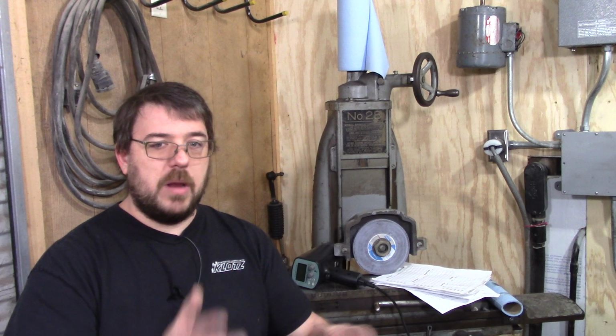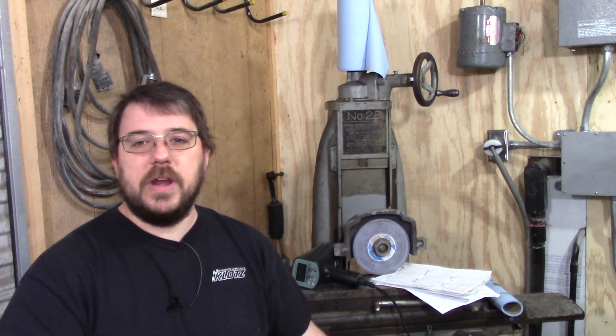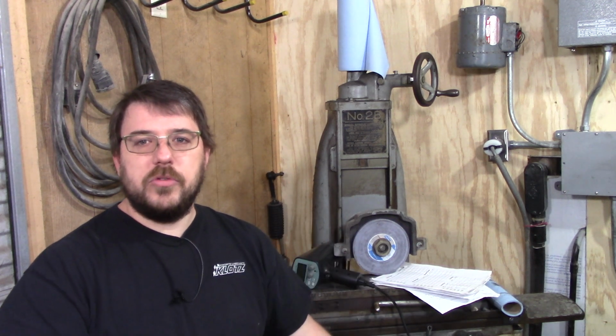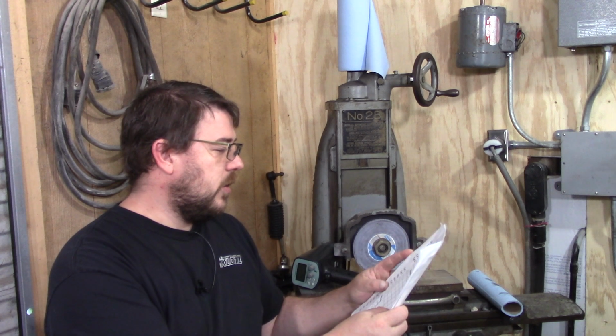The measurements were repeated at least 3 times, and some were done 4 or 5 times with different setup operations to confirm the data that I found, especially when the data was suspicious. The measurements were usually within a half degree of repeatability, though I certainly made many mistakes reading the degree wheel because the angle is awkward. So there were a few numbers that were just way out there, but those were easy to throw out because once you got the right number, you're able to repeat it within a half degree. And the results are right here.